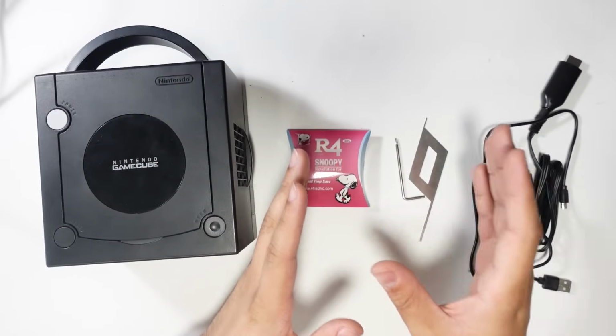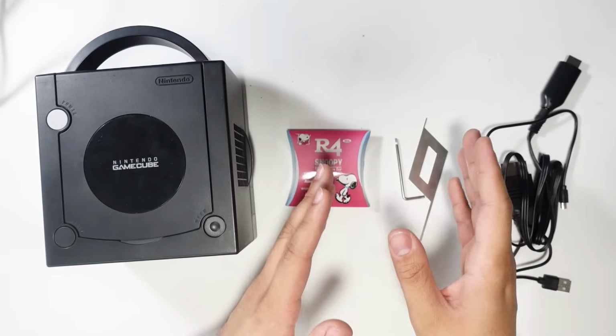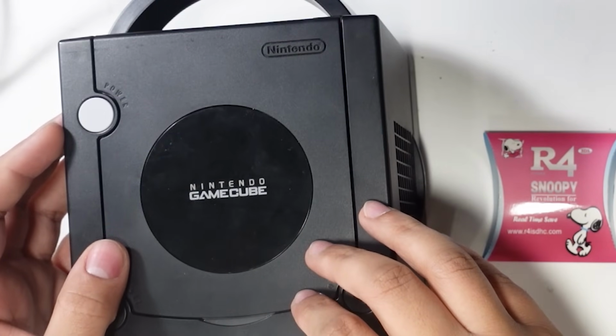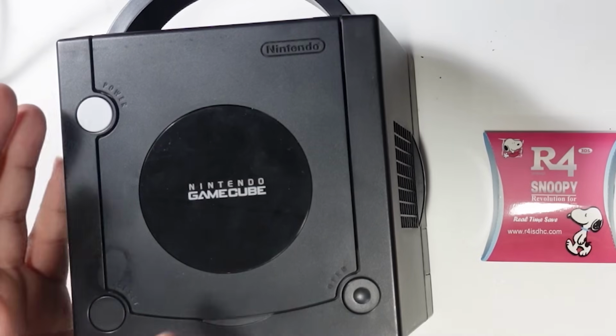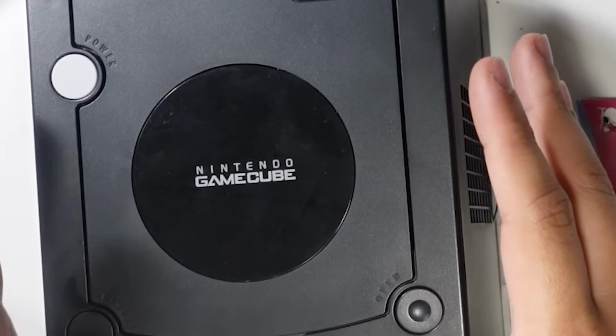All right, so in conclusion for this batch of items from AliExpress, what is the final verdict? Well, for the PicoBoot, it would have been nice if on the instructions they had for it, it told you that you needed to bridge that connector there or solder a switch, because quite frankly, that was a lot of wasted time for something that was super trivial.